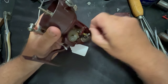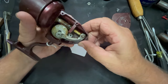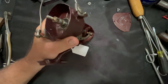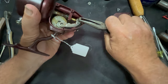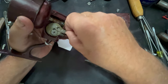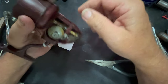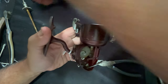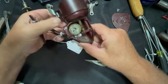And now this pin should come out. It appears to be a pin — yeah, it's a pin. Pull out the pin, put that with the screw, and we'll set the arm over in there. We should be able to pull out on the axle shaft now. Remove the axle shaft like so, and now we can take that arm and set it over there. So all three of those parts are together now.